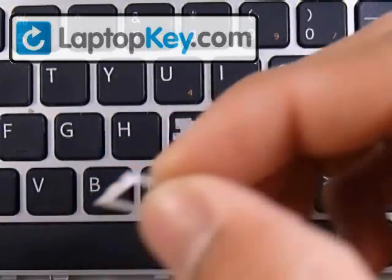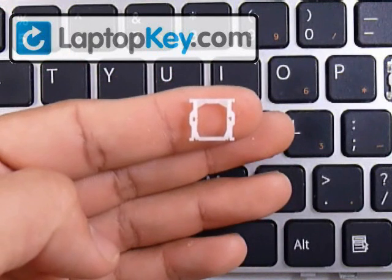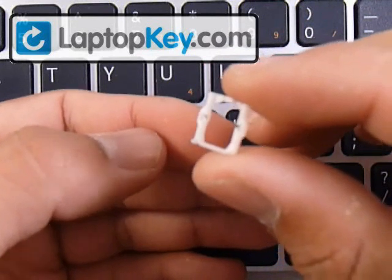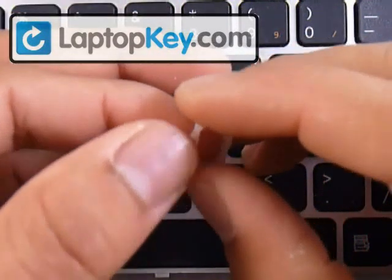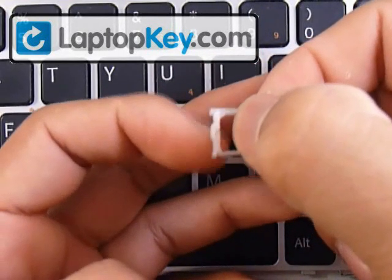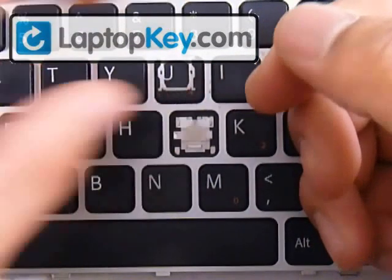We're going to start by determining the position of the large hinge piece. This piece has two pins at the top corners and two smaller pins in the bottom corners. In the middle, it has holes that are going to accept the pins from the other hinge. Make sure not to put this piece upside down — it'll look the same but won't allow the mechanism to work. Feel underneath the vertical bars: if you feel a bump, that side faces the keyboard; if it's smooth, it faces away from the keyboard.